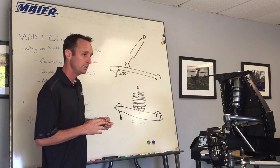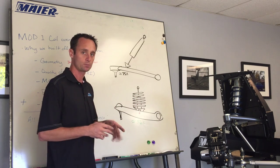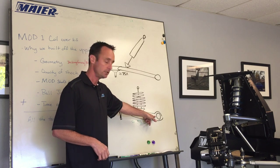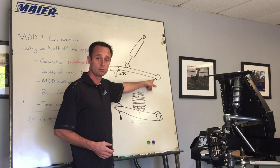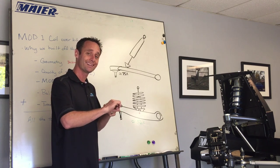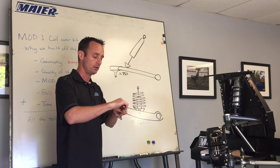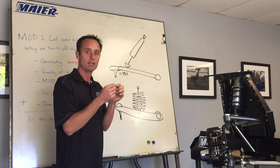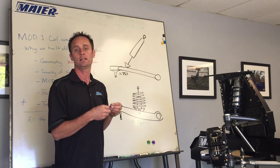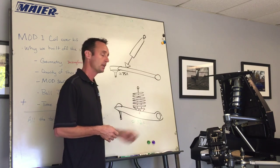Now let's talk about shaft kits and ball joints. With the old school stuff, we did a lot of spring saddle components and roller spring saddles, which freed up movement of the pivoting assemblies. The old shaft kits were steel-on-steel. Our new one uses a Delrin bushing in the shaft kit instead. This allows the Delrin bushing to wear fluidly and smoothly. Because this component doesn't continuously spin, we want the control arm to have a broad, wearable surface area. A bearing gives you little needlepoint contact that just rocks back and forth, rotates a divot into the race, and destroys itself. A broad hard bushing with a lot of wearable surface area is really free-moving.